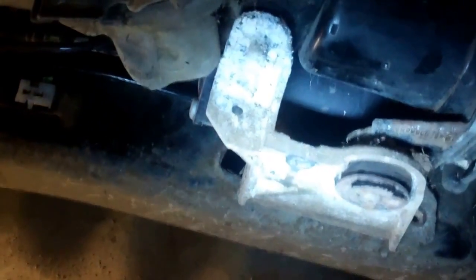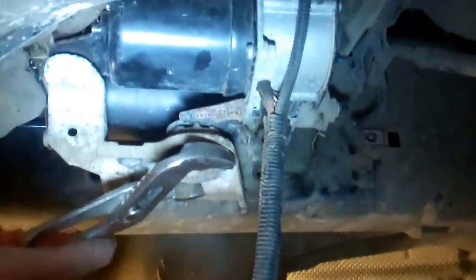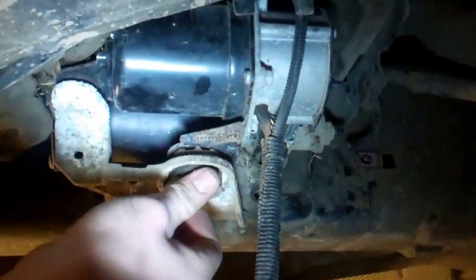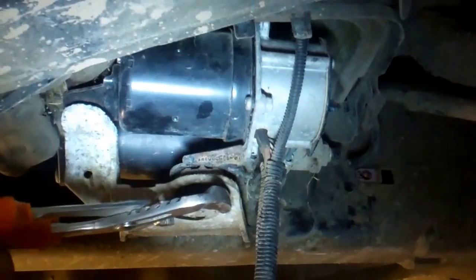Right then, what are we doing next? Right, okay, two the same. Right, so somewhere at the top of that L-shaped bracket that's nicely illuminated there, there is a nut. We're going to go and look for that. I guess he's another 10 mil. Yeah. So we're struggling to see the top bolt, so we're going to try and loosen the bottom rubber mount that's holding the compressor into the bracket to see if that allows that.